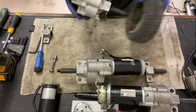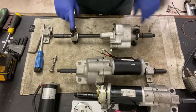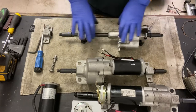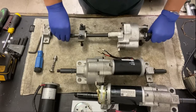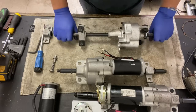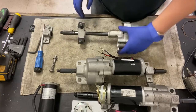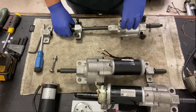So your transaxles, your next thing. These transaxles have three bearings, one at either end and one in the center for the drive shaft. The newer transaxles have a cover over there, like a solid cover. It seems to be a better transaxle than this first version. It's probably a first or second version, but these should turn freely, like it was doing. That's like a freewheel, so freewheeling the scooter. And if it isn't freewheeling, then you may have some kind of problem inside of there.